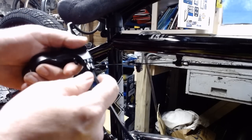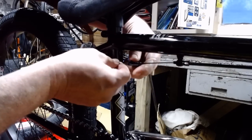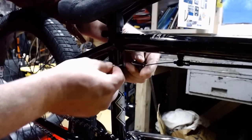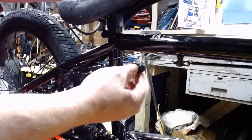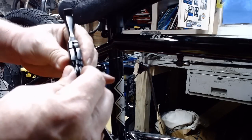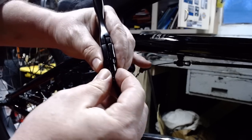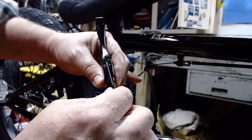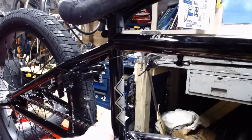So we are going to swap this out. Step one — you have a little adjuster here, and we are going to crank that all the way in. We will pop that right off. Now if you can't get this off, you would have to undo the cable or loosen up the nut back here. There is a little notch here in your adjuster and in your locking nut, so you want to align those up — that way you can pull the cable through forward like that and bring it around. You got a little lug there — pop that off just like so.